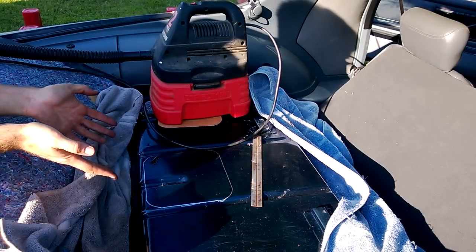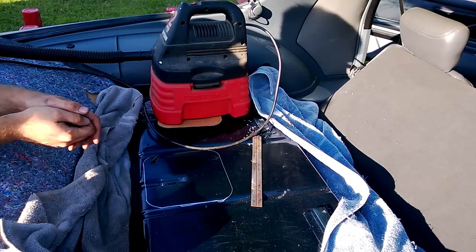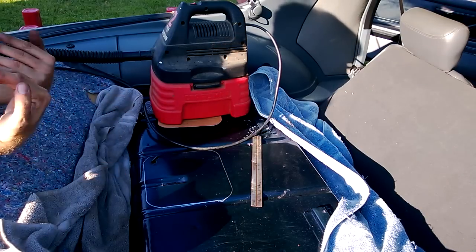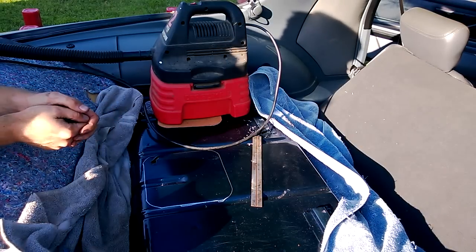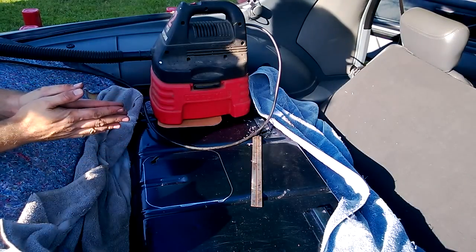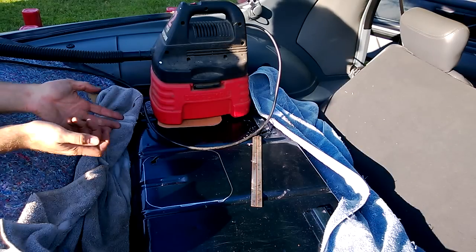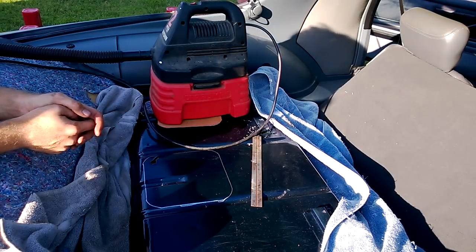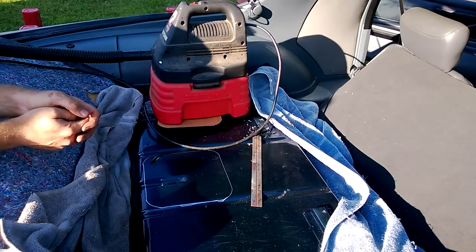I feel like this really isn't hacking on the car too bad. There are plenty of holes throughout this car that serve no purpose whatsoever, and this one serves a major purpose. I just can't imagine why you wouldn't want to fold your seat forward, pull this carpet up, open up this panel, and change your fuel pump. A lot of people don't have to change their fuel pump that often, and that's fine. But the one time it happens, I can just go to Advanced Auto or AutoZone and get a stock pump to get me back on the road — that's worth it to me. Plenty of factory cars come with this. The other thing is I have a Racetronix hotwire harness to put in here, and dropping the tank just to do that also seemed like a lot of work for nothing. So I'm going to cut this panel out.